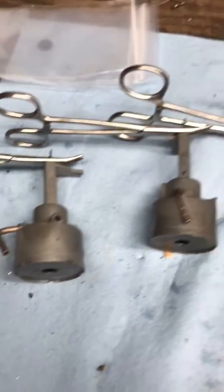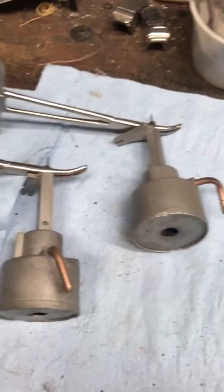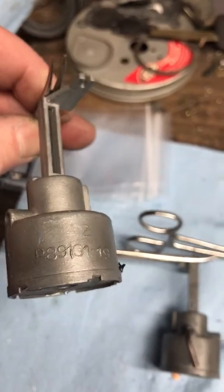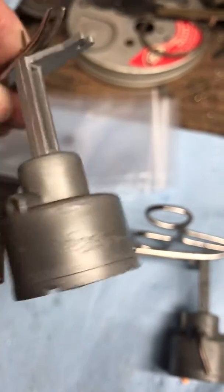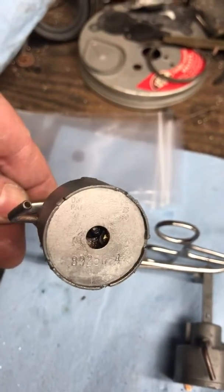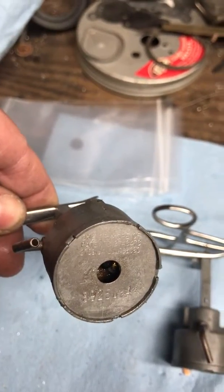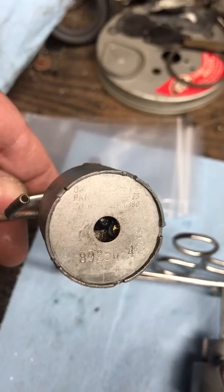Here we have coordinators today. I've done washer pumps, so I figured I'd show everybody some of the differences of the coordinators for 58 to 62 Corvettes. All 58-62 Corvettes had an 89 101-19 coordinator with the tube mounted on the side versus on the top, and they were all pointed at about a 45-degree angle up, versus some out there that are 45-degree down.